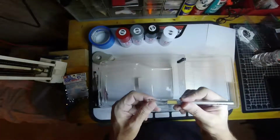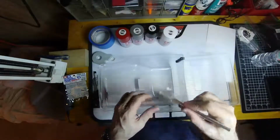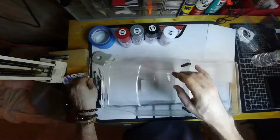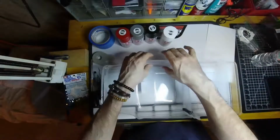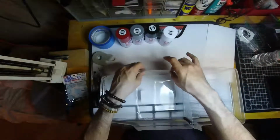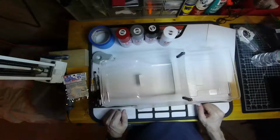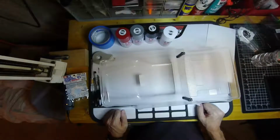And if you're not really, really gentle with that, and you do a really light cut, you're actually scoring the body. And when you have a score in plastic, you're asking for it to crack. That's just another stress point you're going to put on your body where it's going to crack. Okay, so I've gone off on a huge tangent, and I've rambled quite a bit.